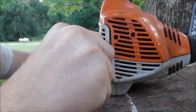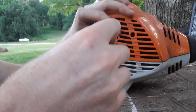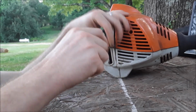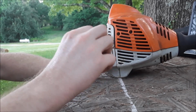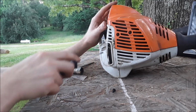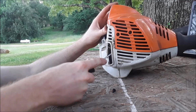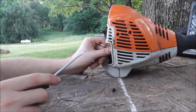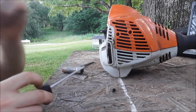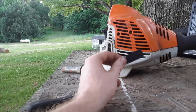And you can see the screen usually towards the bottom of the muffler. This one has a flathead screw holding it in there. So instead of pulling the whole muffler to start with, I'm just going to pull that screen. There's a screw. It's caked in oil. So I'm going to bet this screen is pretty bad. Take your screwdriver, needle nose pliers, something like that, and jerk that screen out. I'm going to try to put this against a background where you can see.